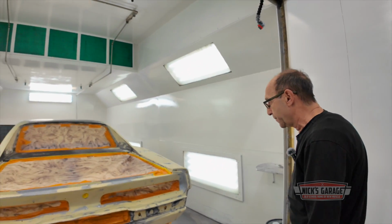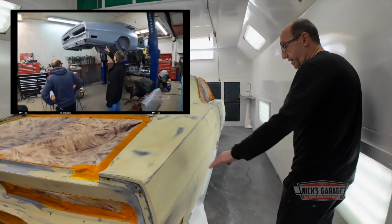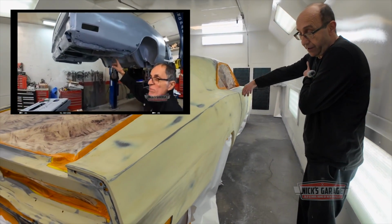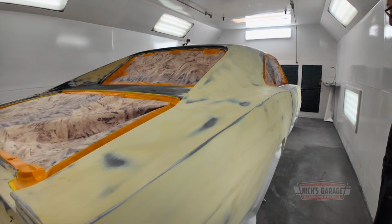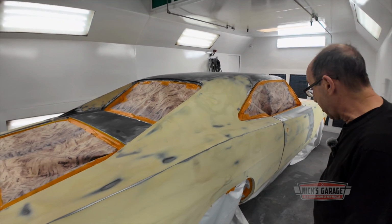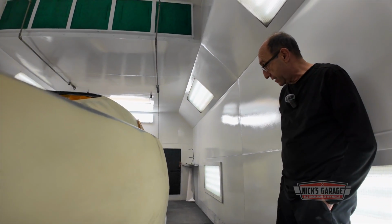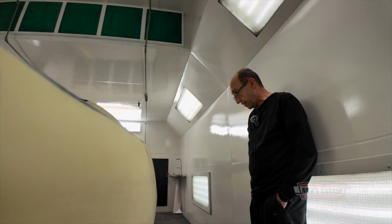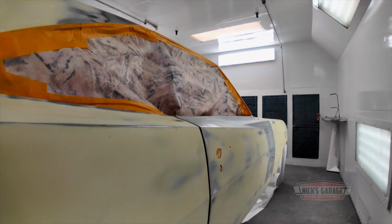It's impressive. These were the AMD quarter panels. As you can see, they took a lot of work. They were very wavy. I'm still grateful that quarter panels are available for this car, that we had something to work with. We've sharpened the lines on the car. As you can see, the lines are very sharp and crisp. They will be dulled out once we sand down the polyurethane, but this is a good way for us to see that the lines are straight, and that same line follows through the whole car.